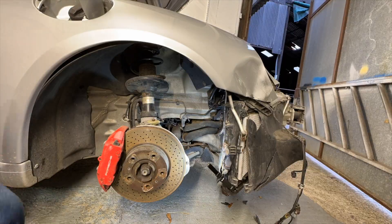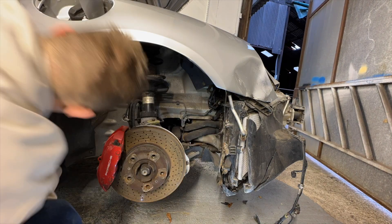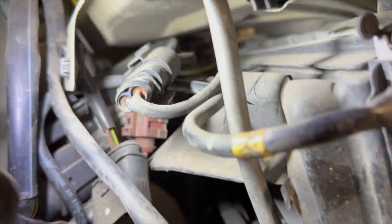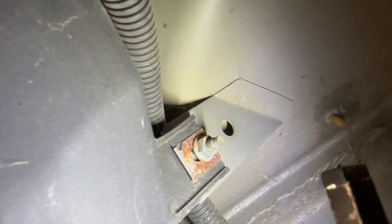Now that the headlight is out, I'm going to try and get this wing off next. Having a quick look around, it looks to me like there's a little bolt up underneath here that needs to be removed, which holds the wing on the bracket. I'll take this bit off — I'm guessing it's just up underneath there. I can also see I have the washer bottle reservoir in here, so I'm thinking it'll just be a case of wiggling that out of the way, and then there must be a couple of bolts up behind here within this wing as well.